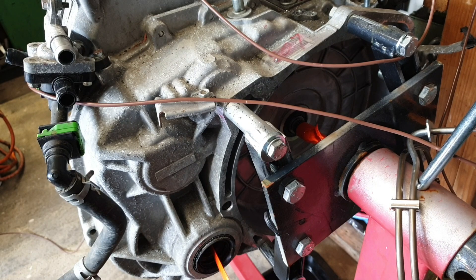Can I remember how to do this — T4, generator only. And if I go, we can use a little bit less torque here, let's go for F12. Oh yeah, we're generating. We can go to zero — I don't want to regen because I'm not connected to a battery here. If I go R12 — there we go. And S for zero. Now if I go back to T0, we can shut the inverter off.